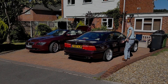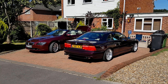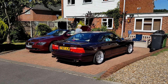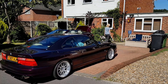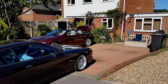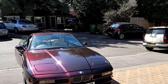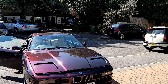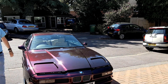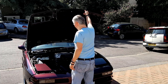The first thing to do is get the car facing up a hill. If you've got an empty cooling system, get someone to help you push it down the curb so the front's higher than the back. Put a catch can under the car, because antifreeze is highly poisonous — it attracts cats and dogs because of its sweet smell and they will die a horrible death if they slurp up any antifreeze. When we finish the procedure we'll wash the drive down as well to dilute any splashes, but it's very important to have a catch can in place.